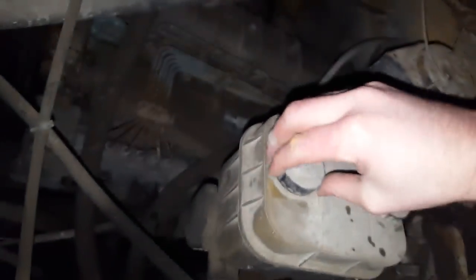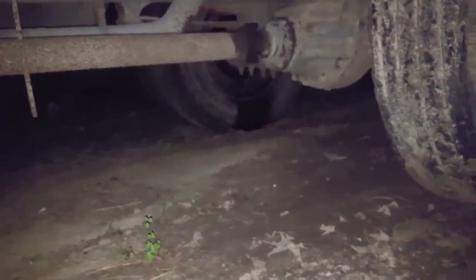Alright, just found my first big problem with the bluebird — it's not a bad one, but it's definitely not a good one. I went to remove it and the brake pedal went to the floor. That's not good. I went and looked back at the rear brake calipers, and if you look at the other tire, there's brake fluid all down the other side of the tire, so we'll go over and investigate.